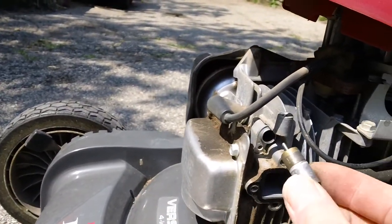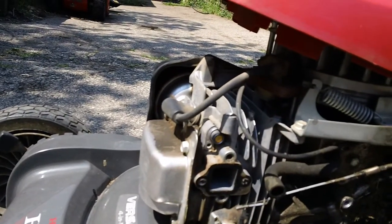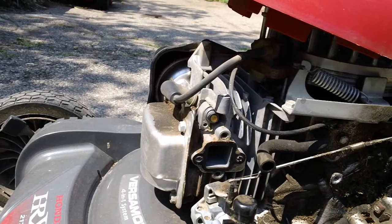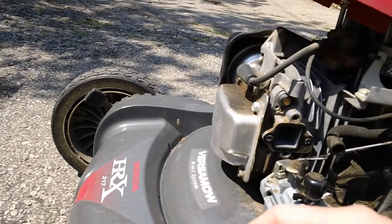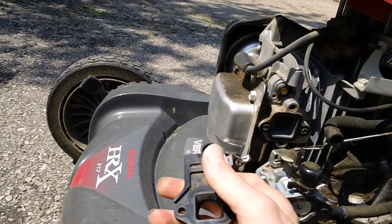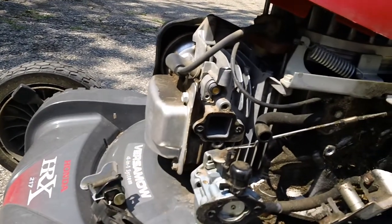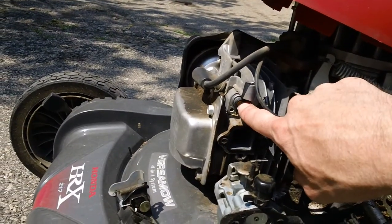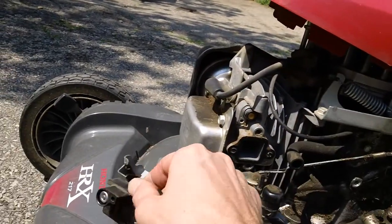Put this thing back inside the hole for the auto choke block — it's all the way in there now. That's how it functions in the auto choke system. This heating element butts up against your back plunger area, and that fits against the control arm. That's how it engages and disengages as the engine heats up and cools down. If you have any problem, always take it apart and make sure it's opening and closing on the heating element first before replacing parts.